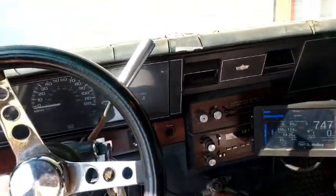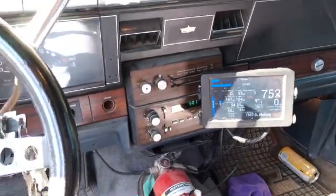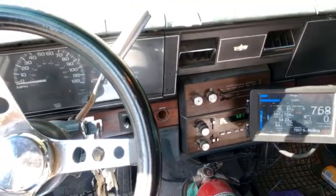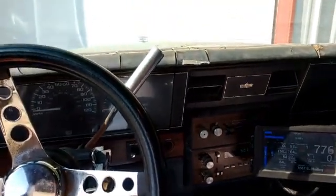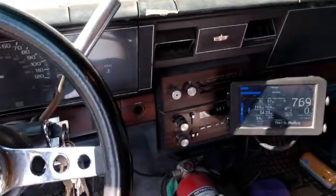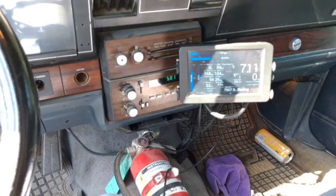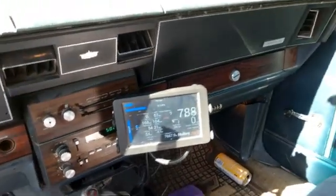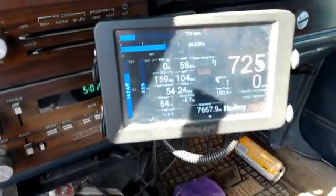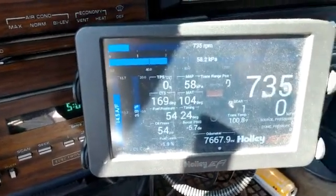It's been a couple days since I've had the car running with the Holley Dominator. A lot of times my dead injector output happens after it's been sitting for a while, especially on a warm day. It was about 90 degrees today when I fired it up. It ran smooth. I shut it off, started it back up, and I'm pretty sure I've got a miss right now. My fuel trims went slightly positive and it's got a little bit of a shake to it.